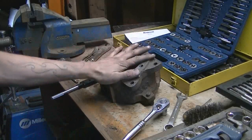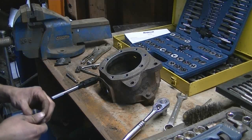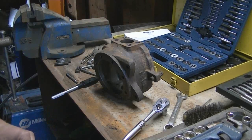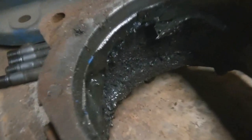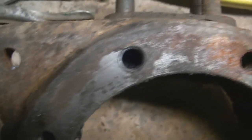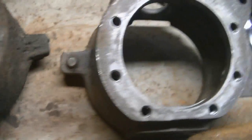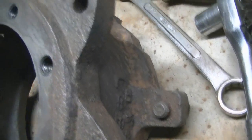I'm probably gonna be setting this one up for the big brake front mod and use it as kind of a prototype to get that fifth knuckle stud in. It's just covered in crap and pretty gross inside — all the bolt holes. I wouldn't try threading anything into those; you'd just strip the threads and wreck everything. After re-tapping it, it's way nicer.